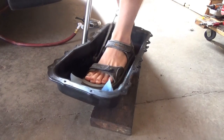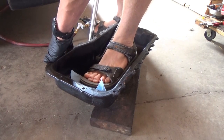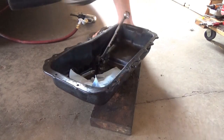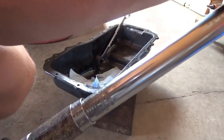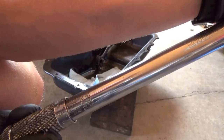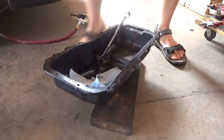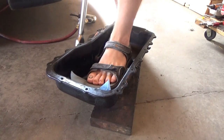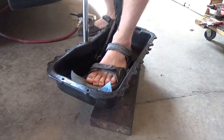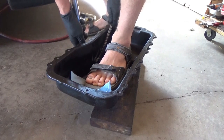Alright, 60 foot-pounds. Make sure that's on there nice. Oh my god, it's ridiculous — I bet they stripped the threads with a freaking impact wrench. Gorillas. 70 foot-pounds — we're getting close to a wheel lug torque here. Let's see, I don't want my wrench to slip off.